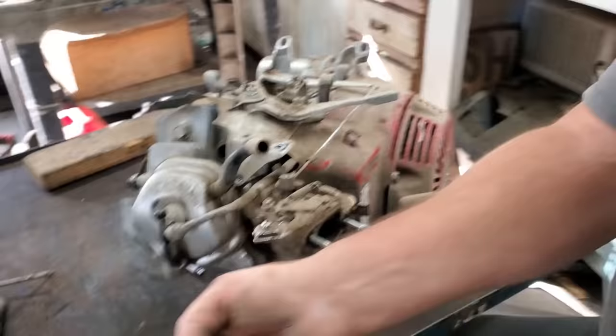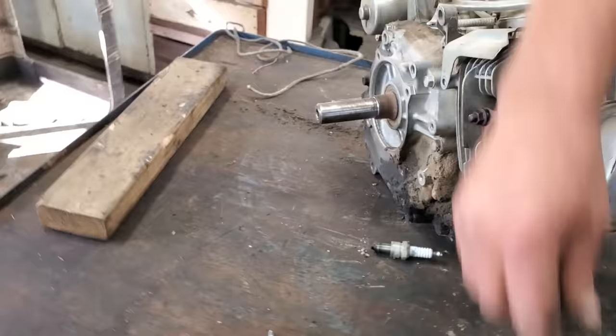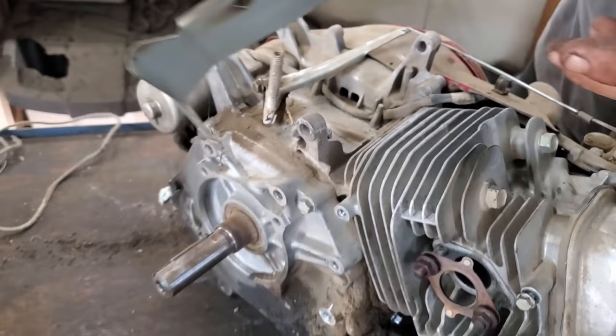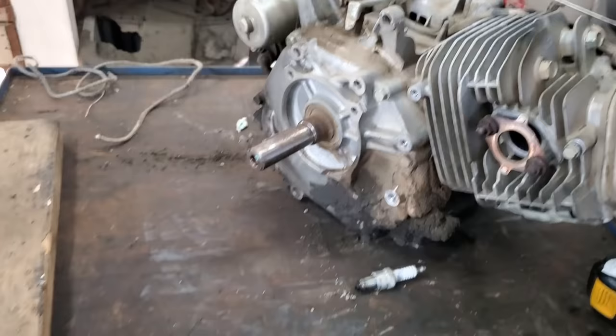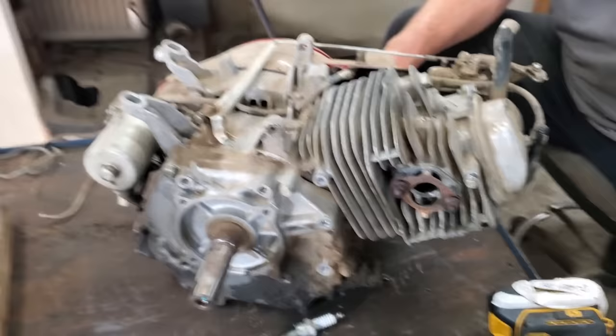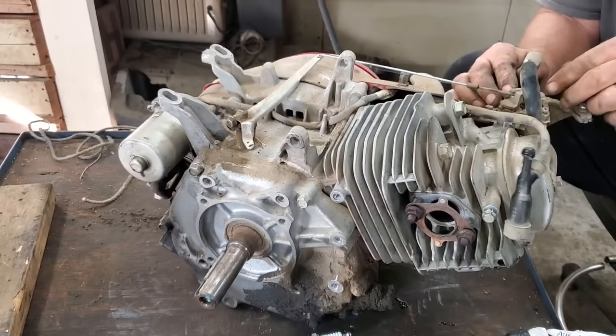If you're unsure about where stuff goes, put the screws back in the holes they came out of. You want to pay attention to your governor spring — it's in the outer hole on this side and there ain't but one hole on that side. Just pay attention to stuff like that when you tear these engines apart. Take a picture — that's what I do. Mrs. T is filming for us. We're going to get this carburetor and intake pieces apart.